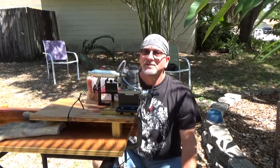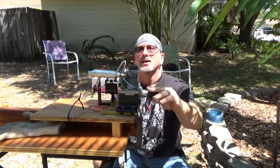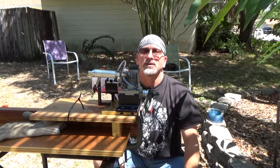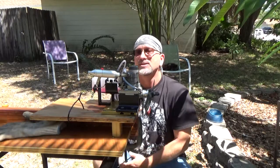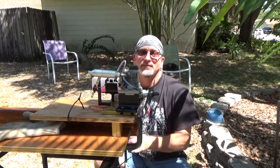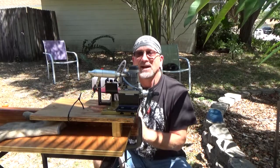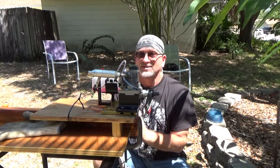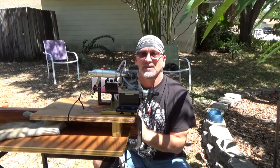I've got a little bit of 5% Omega fuel here, a 14.6 prop, and a well-used OSF glow plug installed. Now, I have to confess that when I came home at lunch today, I did actually fire this engine up, and it fired on the first flip, and it was quite nice, so I've really even already got a high-speed needle tuned. So this video is basically just a performance run for the customer, and let's get going and see what happens.